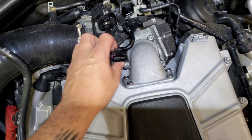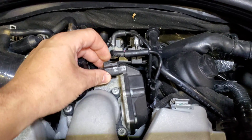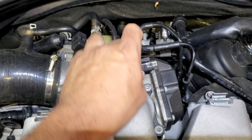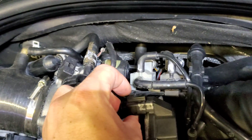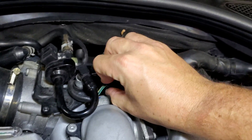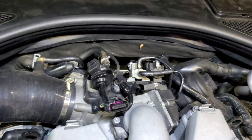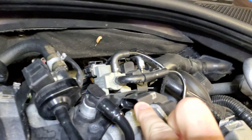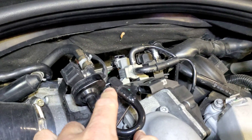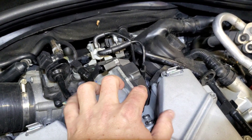First things first, you need to remove the electrical connector from the bypass valve — that's this one that just plugs in right here. To do these, you want to push the pin in to relieve pressure, press down on this tab here, and then back it out. Once you have that removed, get it out of the way. What we're trying to do is be able to get a multimeter inside here, but this line is pretty stiff. So we're actually going to go ahead and remove this, and that'll also allow you to check out the actual gears if you need to.